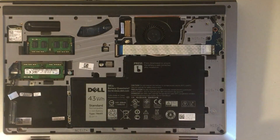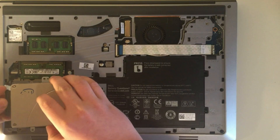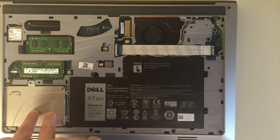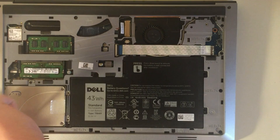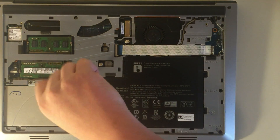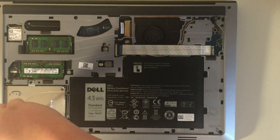Get your laptop and put the new drive into that space, being careful not to break the SATA port. It should click into place. You need four screws to put the SSD or hard drive back into place — screw them in, making sure to go around and that everything is tight.